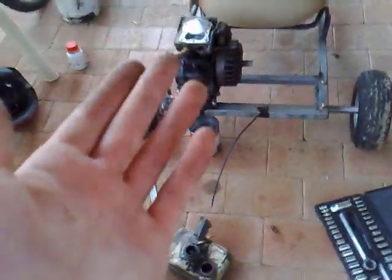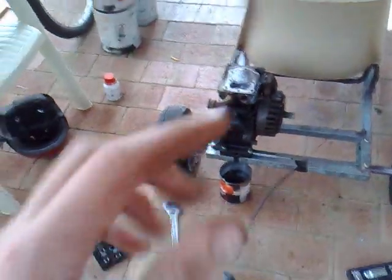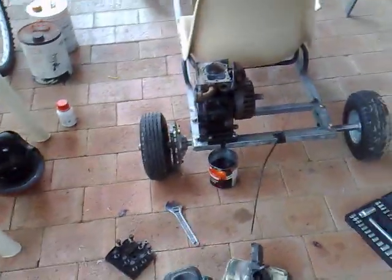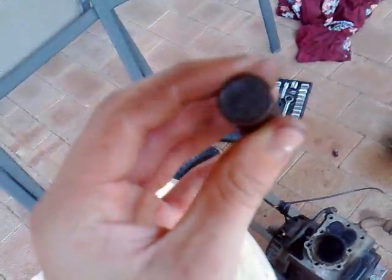Because these lawnmowers — they're made for lawnmowers, they're not made for go-karts. Go-karts create a lot of stress on the chain end. Lawnmowers don't need a lot of stress. These shafts, if you look at them, they're just really bad quality — they're not made for go-karts.